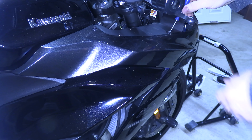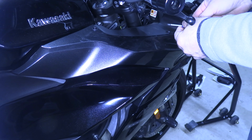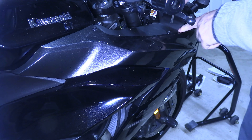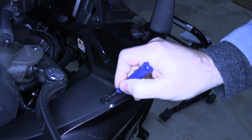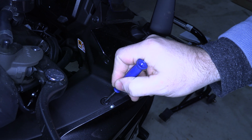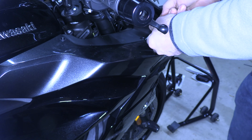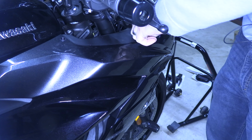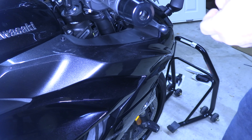The first thing you're going to want to do is remove one of these quick tabs — or quick connects, or whatever they're called. Using a small jeweler's screwdriver makes this really easy. All you have to do is push down the middle, get under here without messing anything up, and lift up. They make tools for this, but it's pretty easy. Set it to the side so you won't lose it.